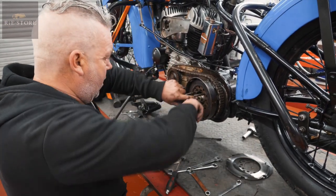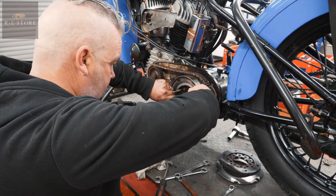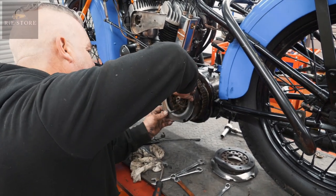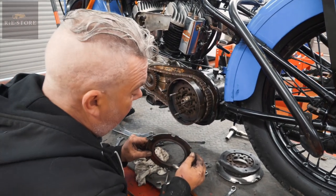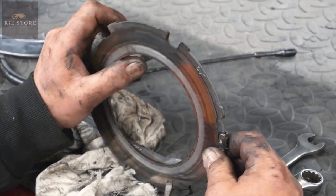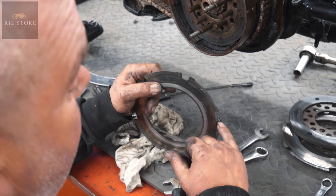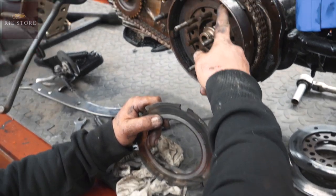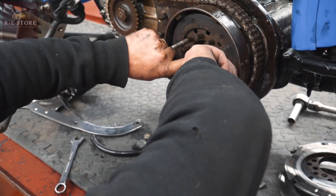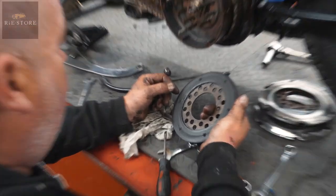I can put new ones in there — they should be clipped in. All the bearings are falling out of everything. They should be clipped in there like that so they don't fall out — those ball bearings have pinged out. They should be clamped in there properly. What's happened is instead of being smooth operating, it's just bashed those straight into the edges. So it's just mullered them. And with the gearbox hanging undone, you'll never get it right.